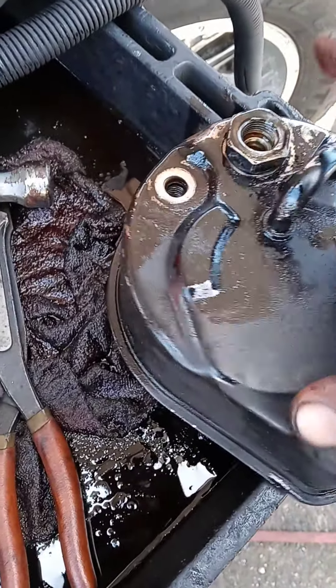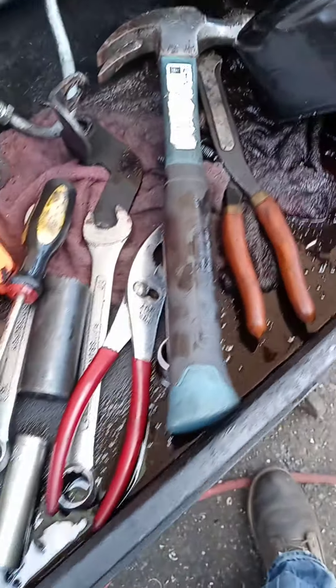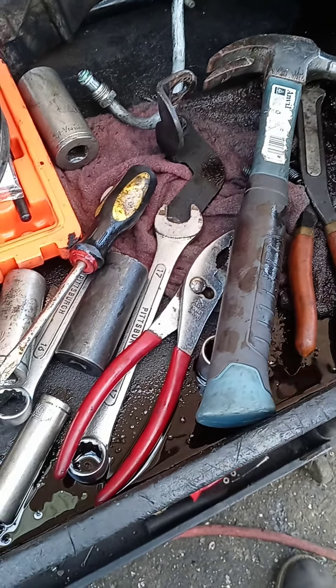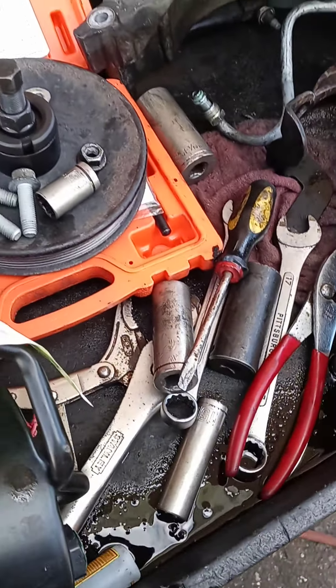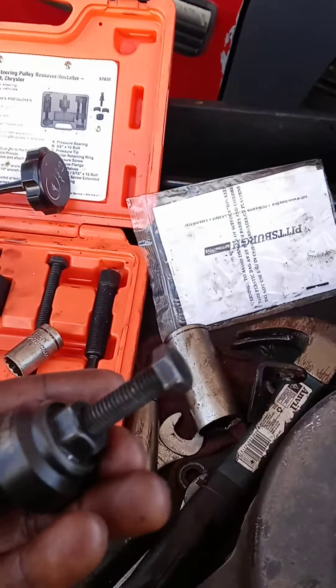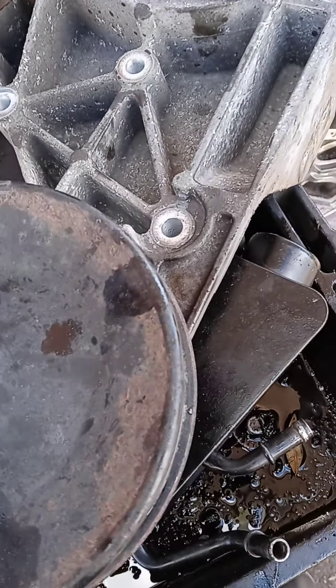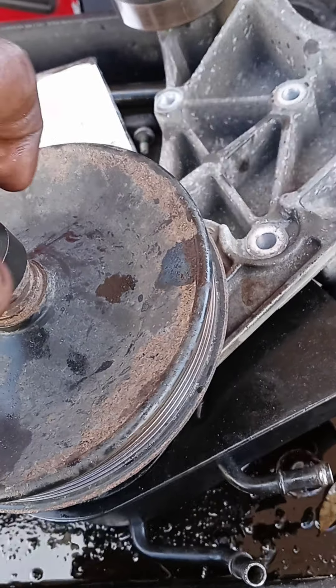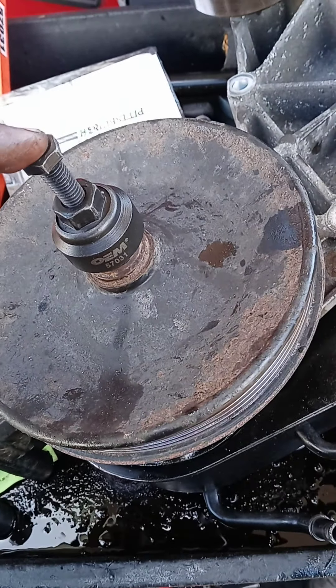So once you get the — what is it — a 1-1/16, might be a 1 inch — get that big nut off here and the two 11/16 bolts out. Then get your access — so you would take these two bolts out and this pump would actually come out of this housing. It was going to have a big O-ring around the pump. You want to put the pump in, line everything up, put the two bolts back in, then the line adapter here would go in, tighten everything down, and that would seal the pump up against the reservoir.